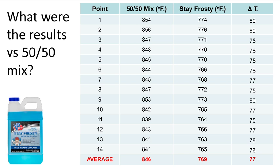Water, which we're using in water-based formulas here on both of these products, transfers approximately 2 times more heat than glycol does. So we're significantly better than glycol here. Even on the high performance version, we're using a small percentage of glycol just to give you some freeze protection. So both of these formulas are less viscous than a waterless coolant, and even over a 50-50 coolant, you're getting better heat transfer, and that's basically your proof there.